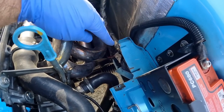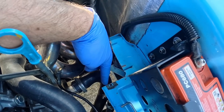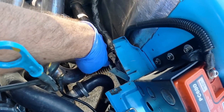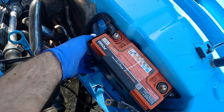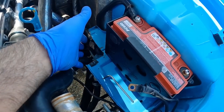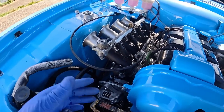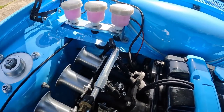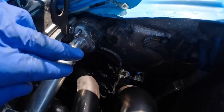This battery tray was already butchered — I had to cut a little bit out to clear the exhaust manifold — but yesterday I just hacked along here and along here, and bent a support out of the way. I may end up removing the battery tray properly one day; the battery's not actually sitting on top of it so it's surplus to requirements. Yesterday I was able to disconnect all the electrics. I also disconnected the fuel lines and drained the tank, because the fuel line doesn't have enough slack for me to pull the engine forward. Today I came round here to continue taking her apart.